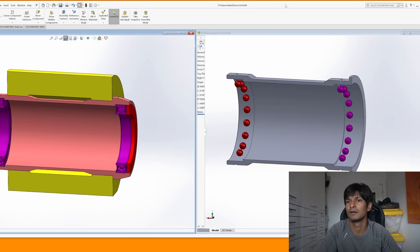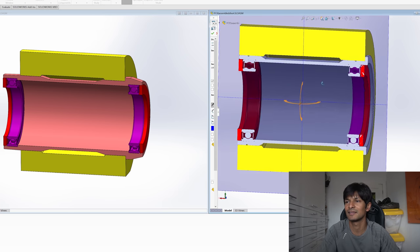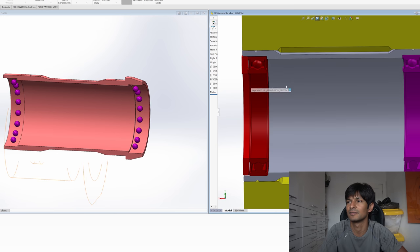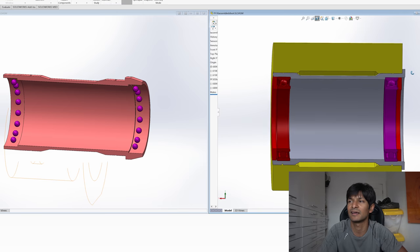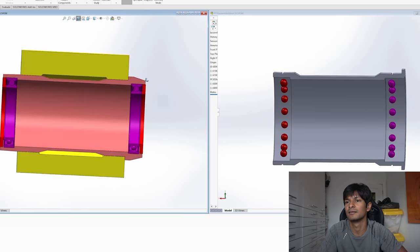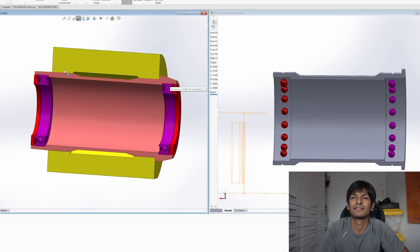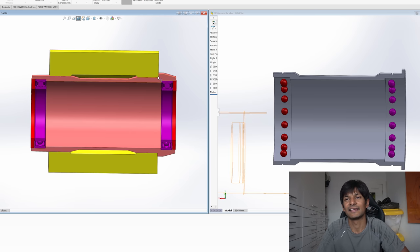Time for the 3D bollocks. There's some bug in SolidWorks, but this is what I've got at the moment. There's a bottom bracket — if I hit tick, that one disappears. This is bearings within the extremities of the frame — it's a narrow design, typical of PF30 and BB30. What we'd move to is this one, where you move the bearings further outwards, outside of the frame's shell.